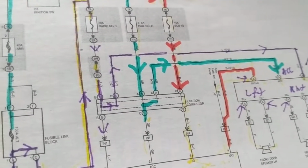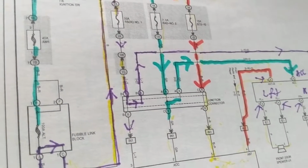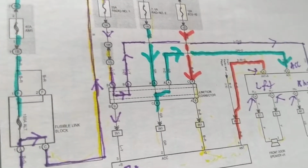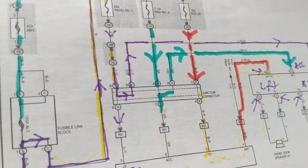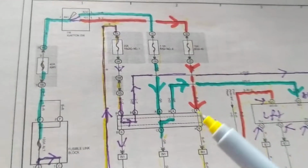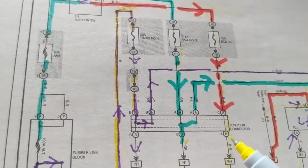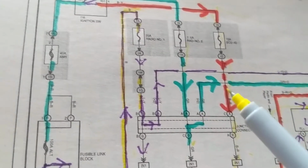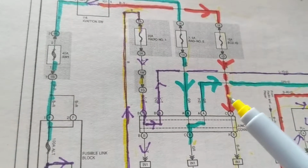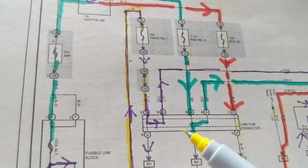So keep in mind, after an installation or anything that's been done lately, tell your technician this was done, and maybe it has something to do with the rapid discharge of the battery. You can have a parasitic load, which I made videos about. When that happens, it's a slow discharge over time. It doesn't happen quickly. If there's a short, it'll happen right away, and it'll blow the fuse. You won't have a parasitic load over time.